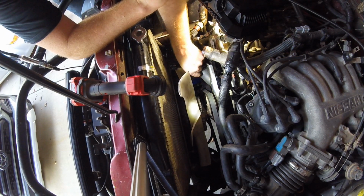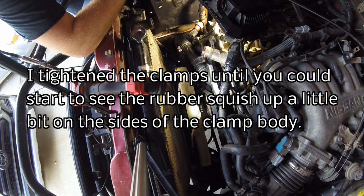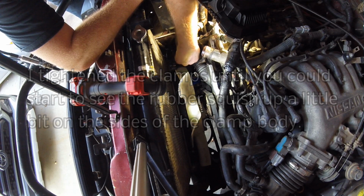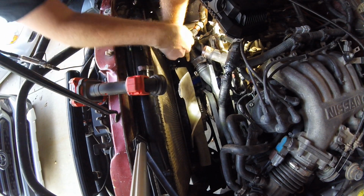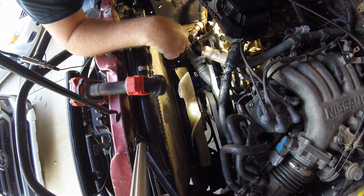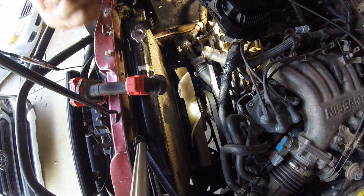I'll mostly put back together. I'll double check all of these clamps. I'll probably check the factory service manual and see if they actually have a spec. There's probably like a length of the threads sticking up from the bolt head that they spec out or something like that. Got a retaining bolt to put back on this bracket, and just got to release the spring tension on the lower radiator hose clamp, and then I'm putting the shroud back in and basically done with coolant